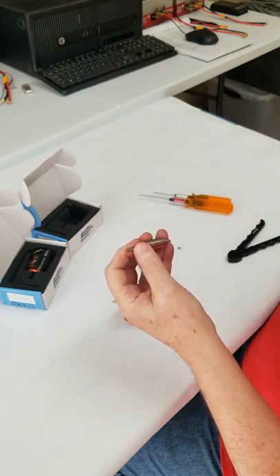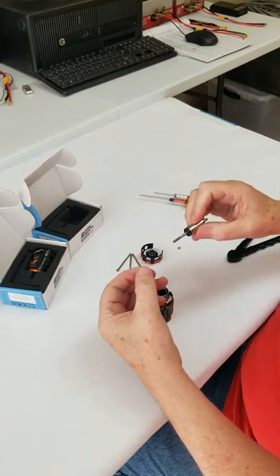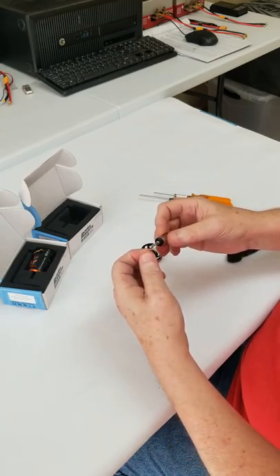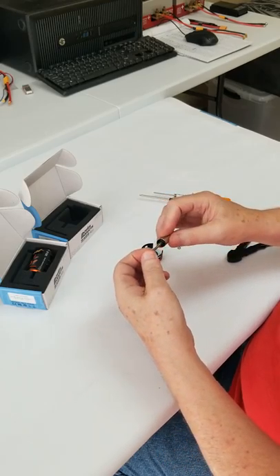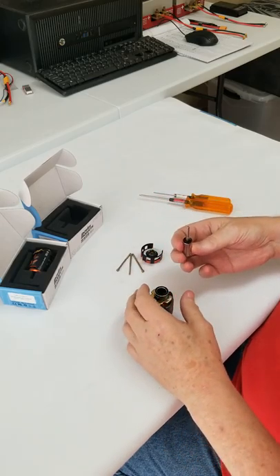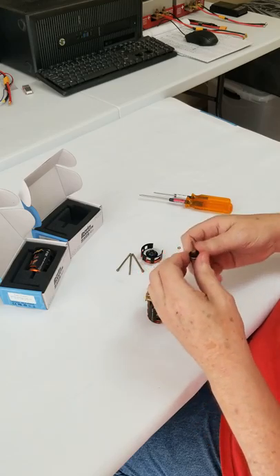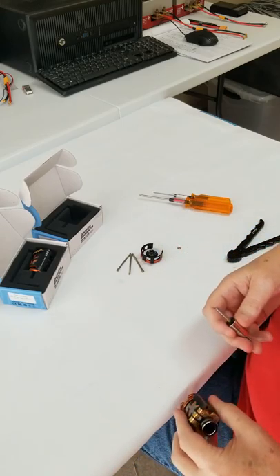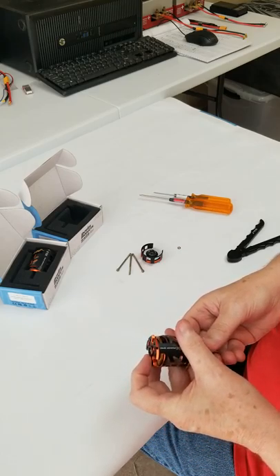Keep steel away from the rotor — it'll do crazy things and pinch your fingers. Now I'm going to put the shims back on: the big shim always goes against the front of the motor, then the other shims go on just like that. I put the motor on its side so the shims don't fall off and so the rotor isn't just banging itself into the can.